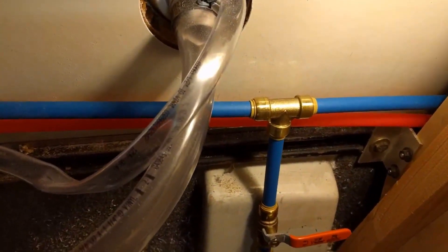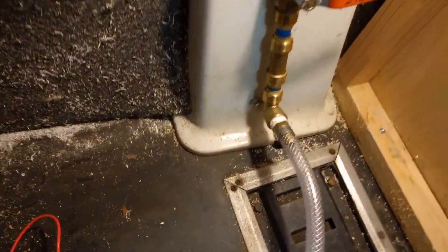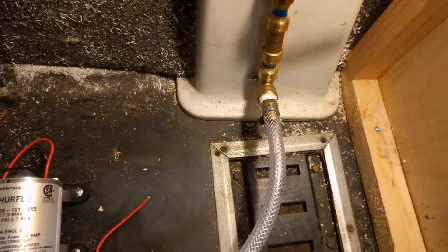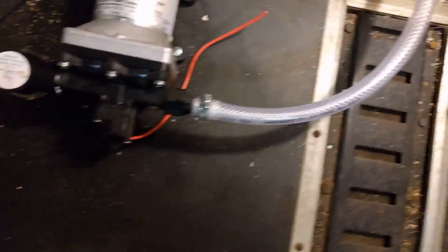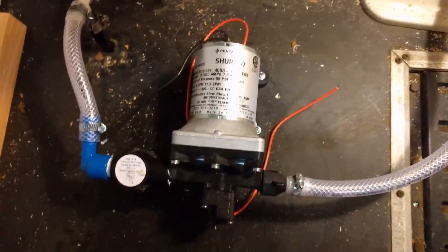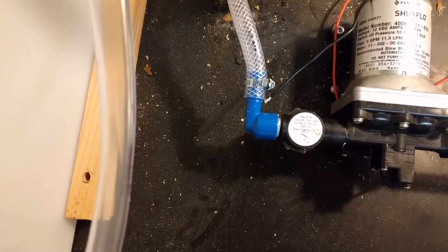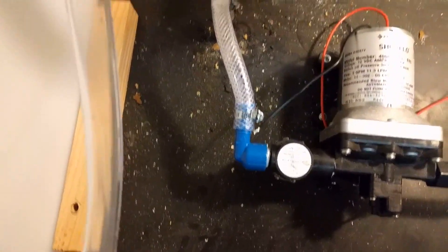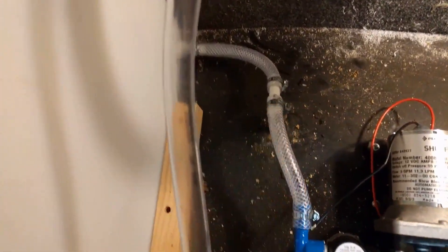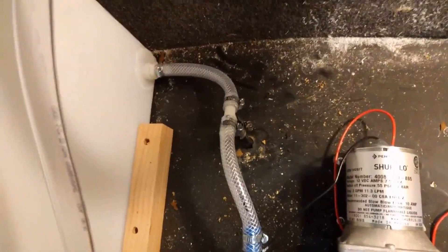The T's in — just a matter of cutting it and pushing it on. I put the extra screws back into the base after I got that lined up, then hooked on the water line. That's the high-pressure side, the pressurized side of the pump. There are the two pump wires. On the suction side of the pump there is the little screen filter right there. That black pipe is for the drain.